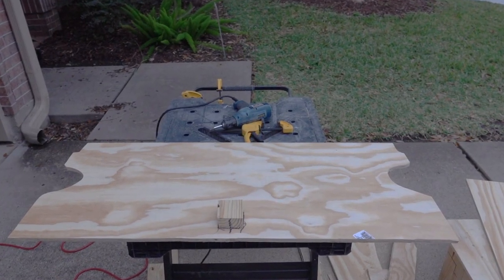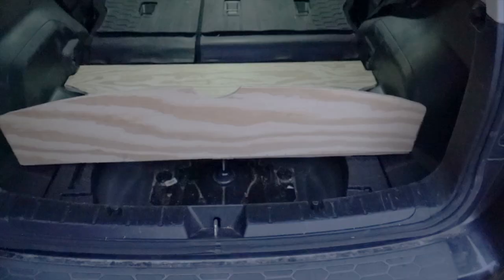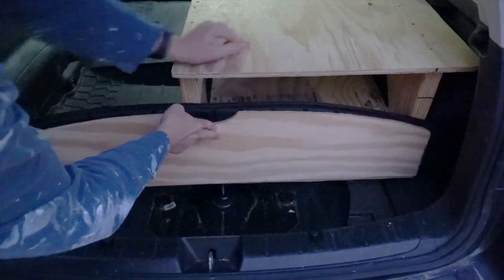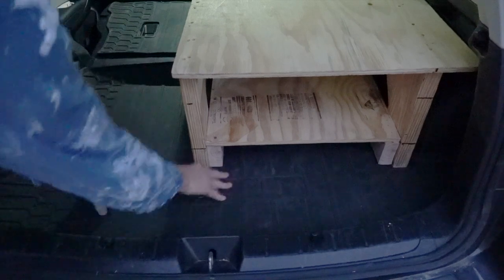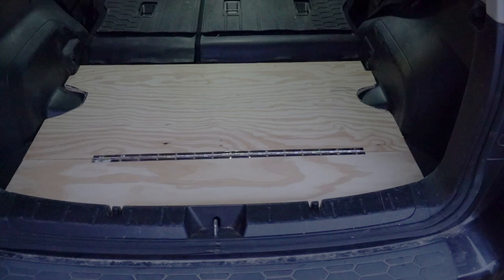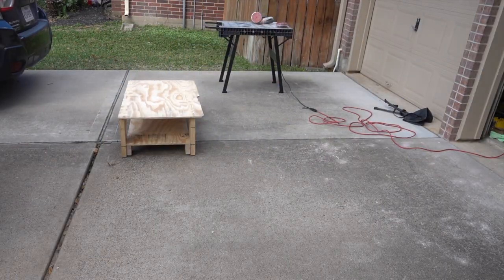I cut out little notches and humps, keep shaving off a little bit more, and before you know it it's all in there. That block and the little pin I talked about earlier — which initially would have held down the spare tire — were imperative to making this functional and structurally strong. The block sits on top of the pin right in the middle; you screw the pin to the adjusted height, you can still access everything in there, and it is extremely strong. The screws came through a little pointy so I grind those off with a grinder.